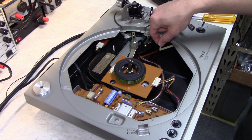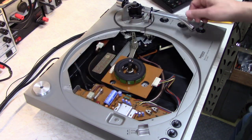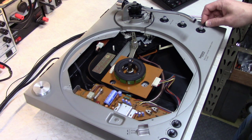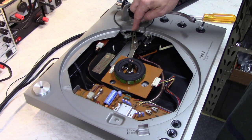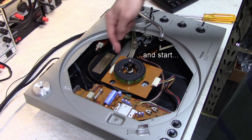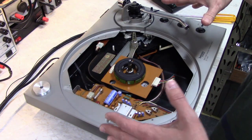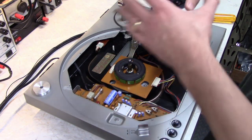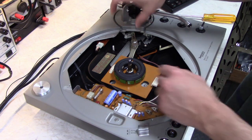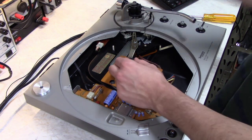This is the power switch that turns on the power to the whole turntable. It connects here so any time the tone arm is moved over it trips the switch, and also when you click the start lever it also trips the switch. This arm right here is for the automatic stop — when the tone arm reaches the end of the record it kicks over this arm, which on this end puts a tooth down into a little sprocket on the bottom of the spindle. The automatic mechanism is driven by the platter motor, not a separate motor, so when this arm gets kicked over the motor moves this slider over, which is what moves the tone arm around, sets it down and moves it back and forth.